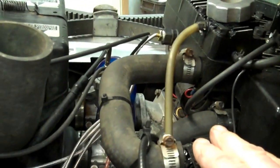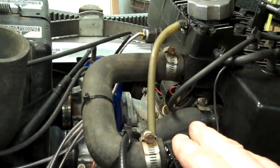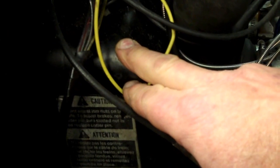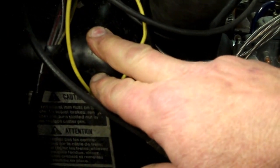There are absolutely no leaks in the cooling system — I've had it sitting here for quite a few days. It has the original air box and of course the two Mikuni carbs on it with the original jet settings set to factory specs. Whoever gets this will need to check the jetting when you ride it so you don't burn down a piston. It has new blue fuel lines, a shut-off and filter, and the tank was flushed. It has a new pickup line and a new anti-backflow filter so it'll keep the gas up and make it easier to start.